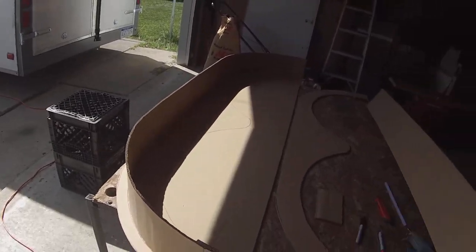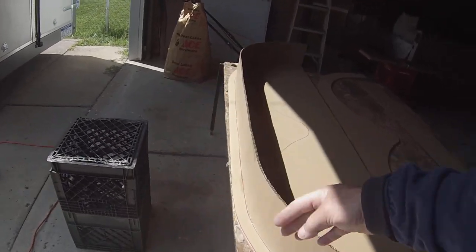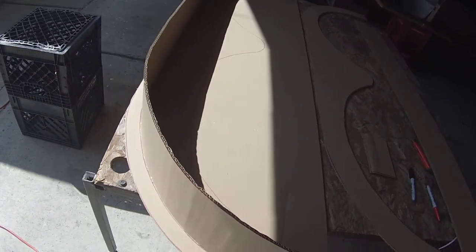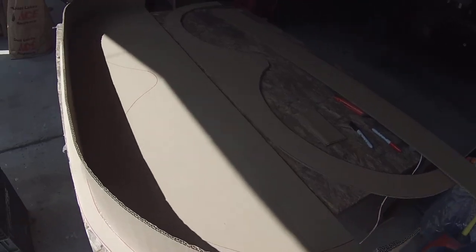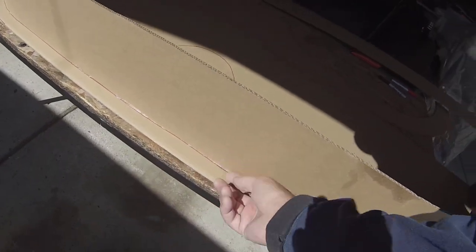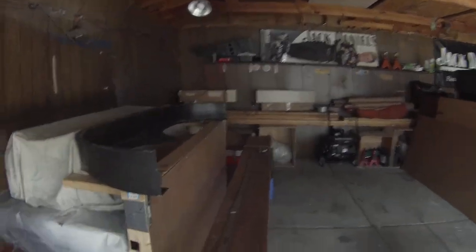We're making a little progress here, we got the fender cover part of the surface glued on — just butt glue, like a butt weld. Put the glue down next to the line, hold it, then move it out of the way, a little more glue, a little more glue. It doesn't matter if it's hanging out here because we're gonna need a fillet here anyway. It's gonna get covered in tape and won't be a class A surface — it's gonna be the inside of the fender. The rough side is gonna be on the outside.